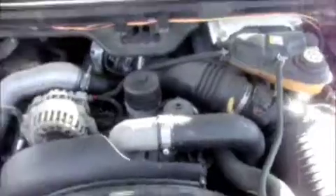The symptoms of a clogged EGR valve on the Power Stroke are that you'll lose power and you might put out some black smoke. A lot of people won't clean them anymore and just replace them, but it's easier to clean them. I did mine last year and it looks like it needs it again.